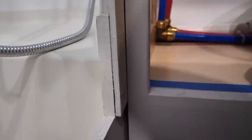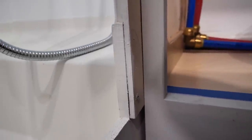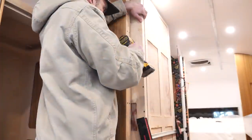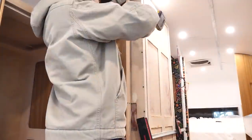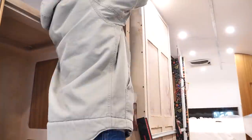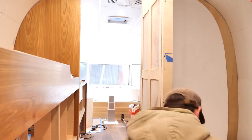So the good thing about that is the acrylic doesn't just sandwich up against the shower pan, where you would have a seam, right? There's a little lip that goes over the edge of the shower pan. It's called a rabbet in the woodworking world. That rests on the shower pan edge and creates a pretty good water connection there. It also creates a way for me to attach the sides.